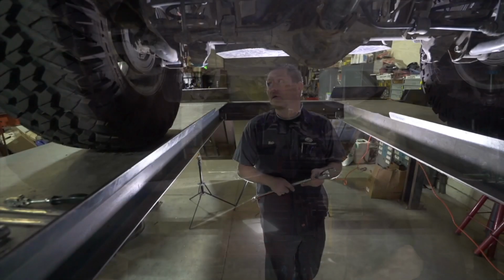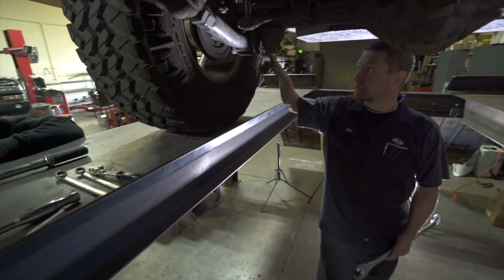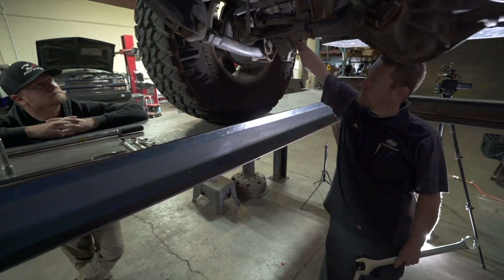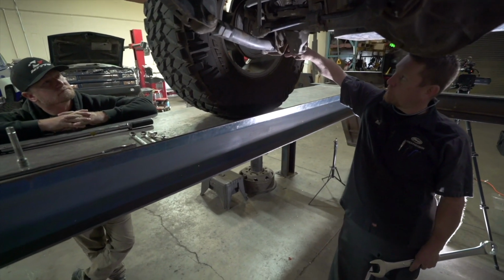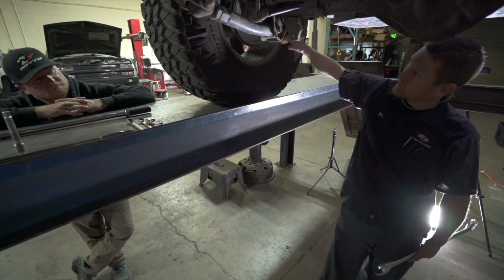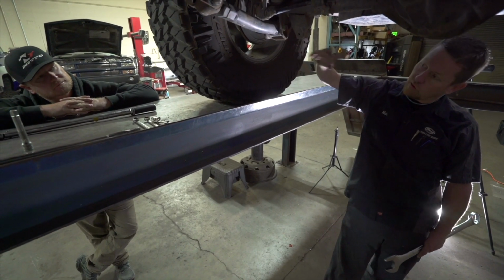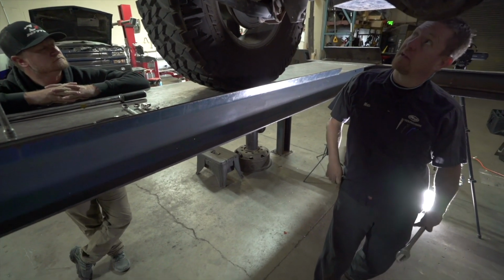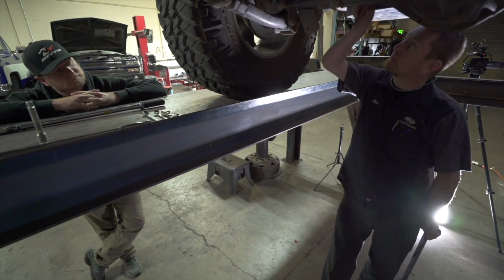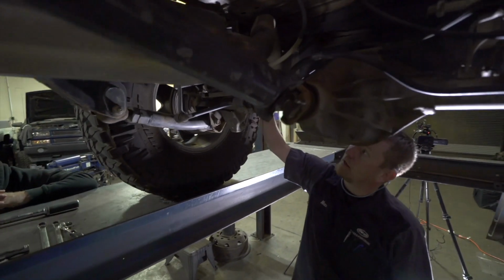When we get it up in the air, we'll pull the tires and we'll check brakes, check all the caliper bolts. I have seen those come loose and start rocking around or even lose one, and I've had calipers hit wheels due to just vibration and lack of maintenance. So we'll check each one of those with all the wheels off, see if we have anything there that's weird.